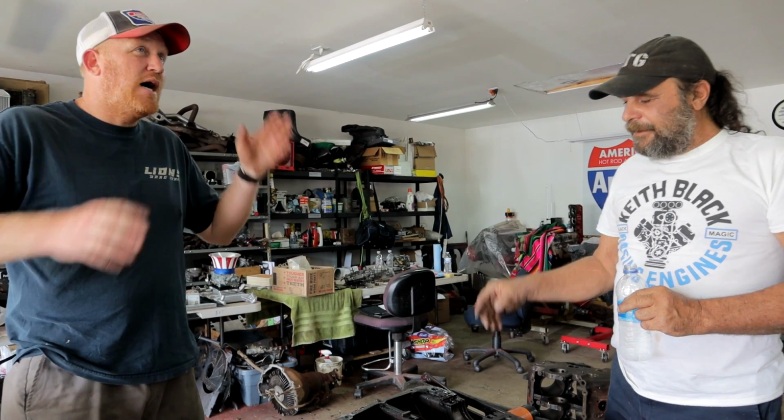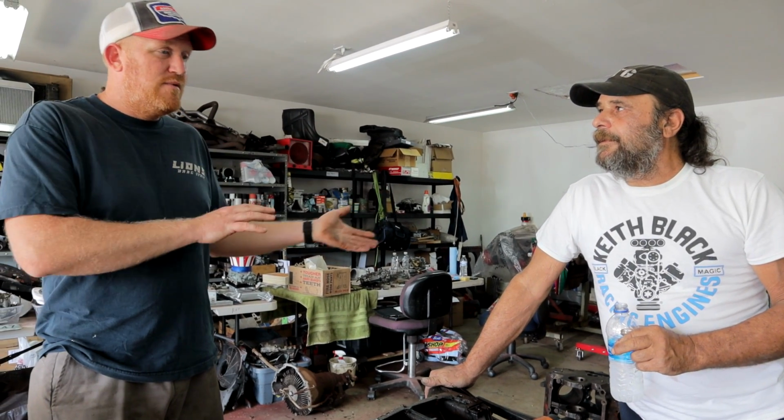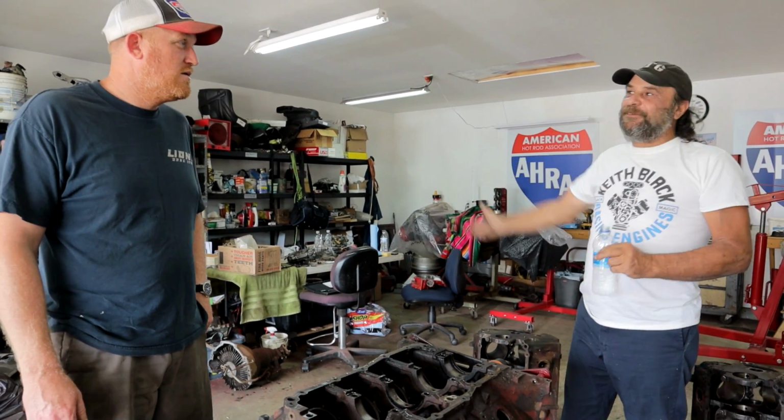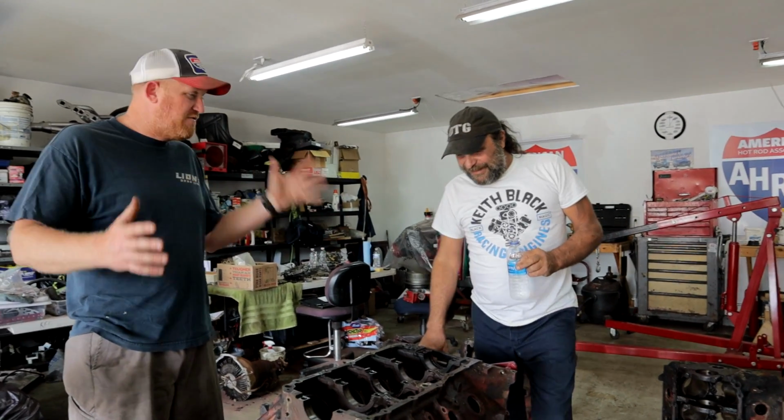Yeah, that was actually a time frame that Buick did that for even the small blocks. So the nail head, in early 60s cars, you open the hood and you're like, a 445 Buick, what the heck is that? Well, it's actually a 4-barrel 401, but it made 445 foot-pounds of torque. Which leads to a lot of confusion because people think Buick must have built like 18 different size engines. But the 401 had multiple different variants.